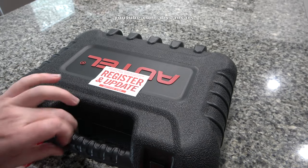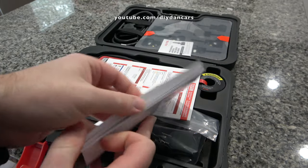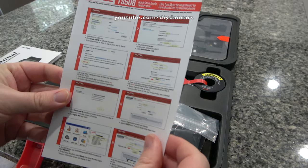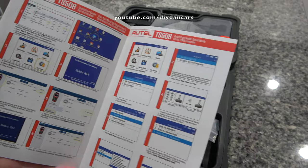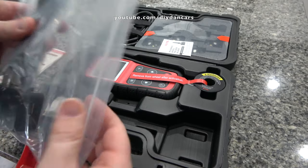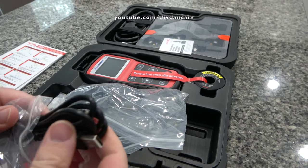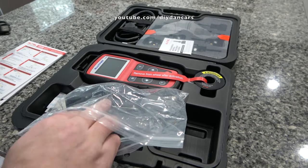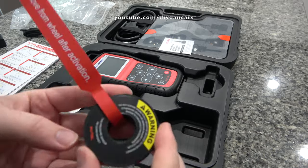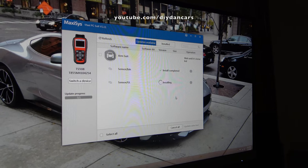I purchased my Autel TS508 as a package deal, which also included 8 Autel MX1 tire pressure sensors. I'll be using 4 sensors for my wife's Lexus, and the other 4 for her Maserati Gran Turismo, which I'll be doing a video on later this summer. The really nice thing about these sensors is that they offer dual support for either 315 MHz or 433 MHz tire pressure monitoring systems. This means you don't have to worry about buying the correct frequency for your car's system, because these sensors will support them both. The kit included a user's manual, a quick start guide, a USB cable, a wall charger, a relearn magnet, the TS508 tool itself, an OBD2 cable, and 8 Autel MX1 sensors.